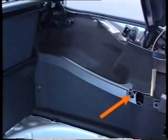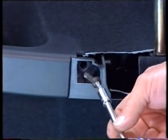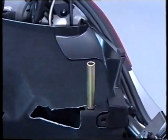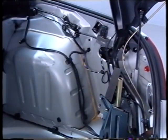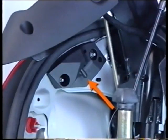Remove the side protective trim and the rear trim. On the driver's side, disconnect the 12-volt socket and the parking aid ECU. Remove the side trim — this enables you to change the boot-locked switches, and on the driver's side, the boot-open switch. Replace the rubber stops for the rear screen.